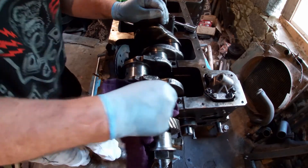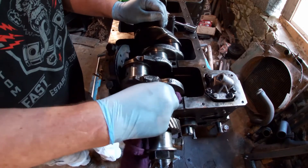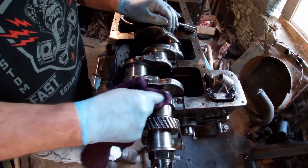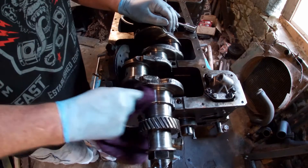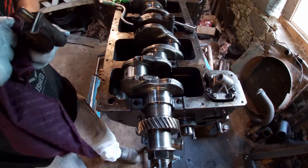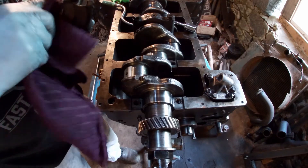I'm going to have to do a bit of research and see if that's too much — not exactly sure what I'm going to do if it is. I'm using a lint-free cloth so there's no detritus left in the engine. This Plastigauge material apparently doesn't matter if it's in the engine — it's oil soluble. I'll have to see if there's a new seal in the kit for the front. There's a seal here for the sump — the one that's on isn't very good, but I can torque it up anyway.